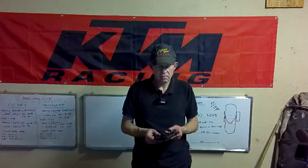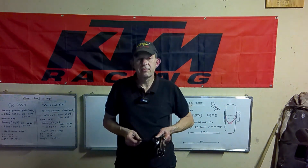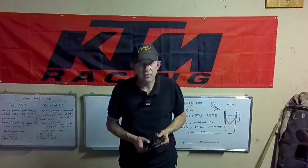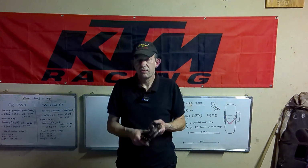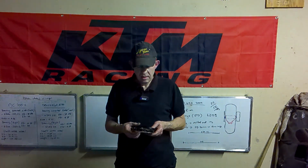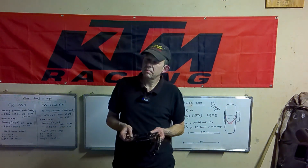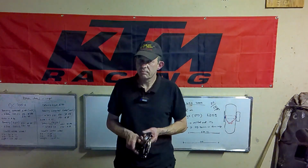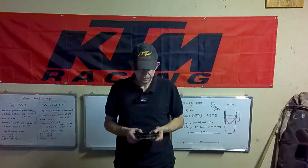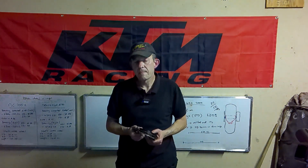Alright, here we have it. Set of clutch plates changed. NC XRV750 Africa Twin. Take the same amount of plates, take the same pressure plates, clutch plates, everything. If you are unsure, you can interchange them. They are the same. And these ones that came out, look, the bike was still running. And at some stage it felt a bit off, slippery, but I had no idea that they looked as bad as they do. So yeah, 70,000 odd kilometers on the clock.